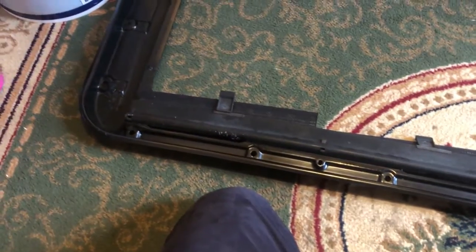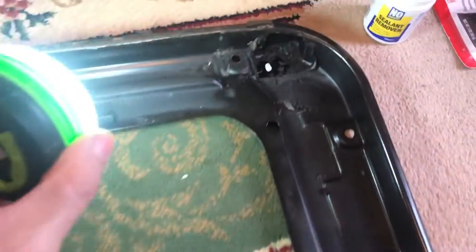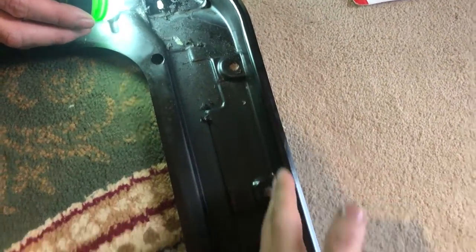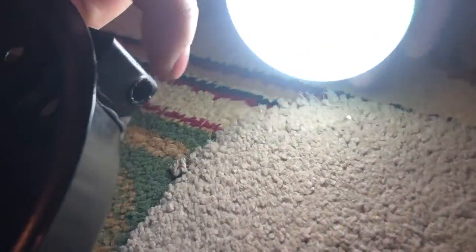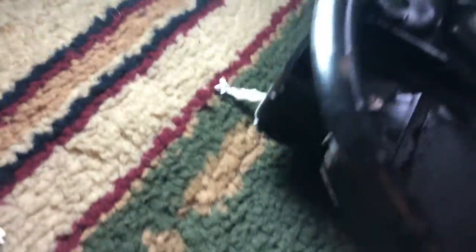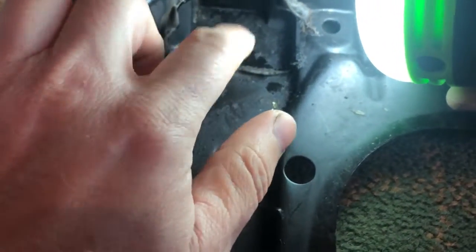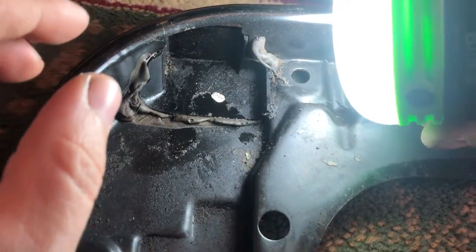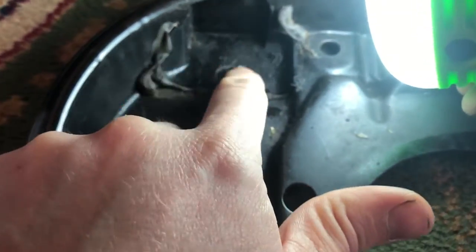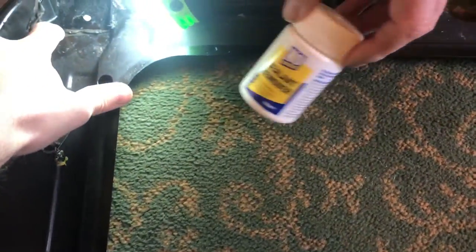We're inside now because the weather's cold. We've got the sunroof drip tray off and we're showing a few bits on it. The water comes down into here at an angle and goes into these drainage channels. On the end there is where it's snapped off — snapped off there and also there. These little plastic pieces: I've got these coming — I'll put a link in the description. There are different versions available — a 3D printed and an injection moulded version. I've gone for the injection moulded because it's apparently a lot stronger.